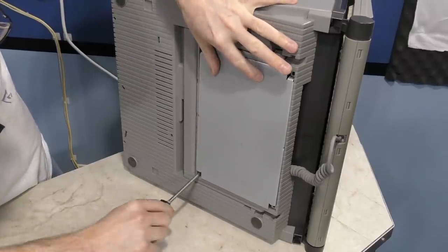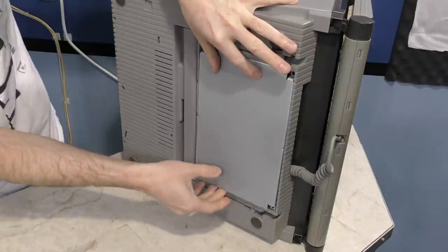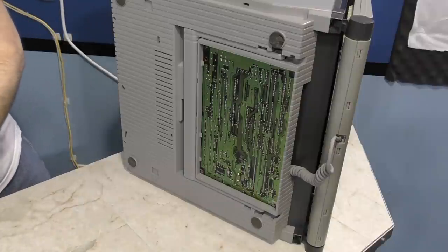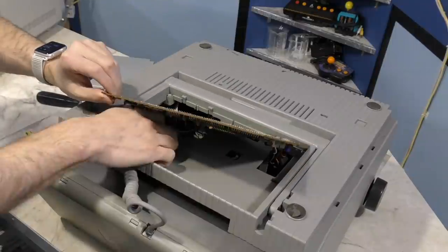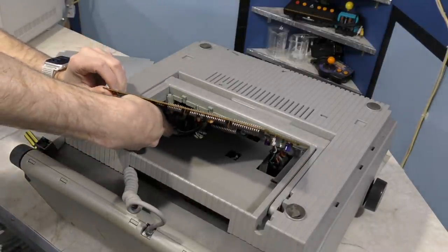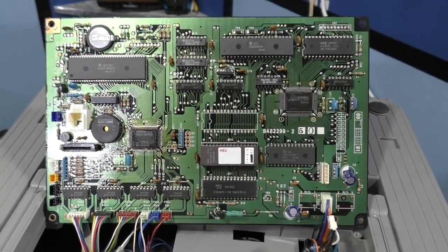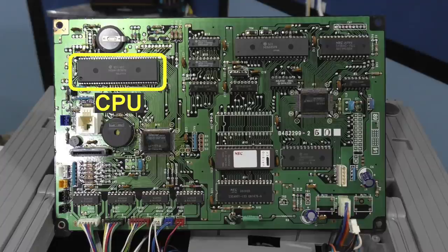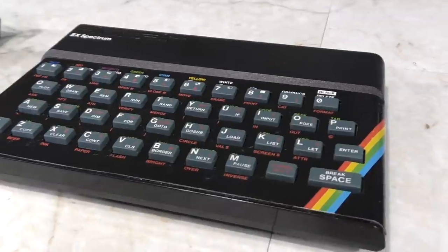I'm hoping this metal plate on the bottom will give us some access to see the motherboard — I'm not seeing any other obvious ways to take this thing apart. And to my amazement, I believe this is the motherboard right here. So looking at the board, this is the CPU: it is a Hitachi 64-180, which is basically a traditional Z80 CPU with a memory management unit and a few other goodies packed in. So this machine runs the same machine code you would find in a CP/M machine like the Osborne or even the Sinclair Spectrum.